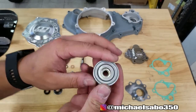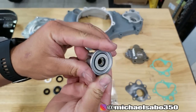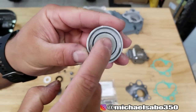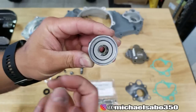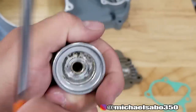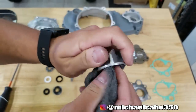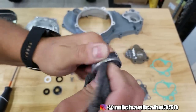I've never built one of these before so this is going to be a new experience for both of us. First thing I want to do is replace this seal in the back here - there are actually two pieces in here. There's this plastic piece that you just take a screwdriver and pry out, and then there's a piece of rubber behind that which should pry out pretty easily as well. It comes right out. I'm going to clean this out with some steel wool.